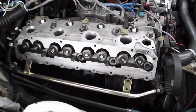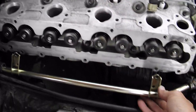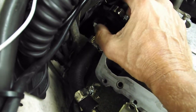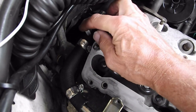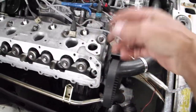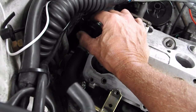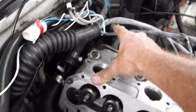So I'm just getting ready to put this back in place, but before I do, I've got to take this tube off. I was just fitting this. This is a little bit of a change from before. I ended up putting this heater tube here in the middle of this line because I don't want too much hot coolant flowing through here and just being recycled back in. So this valve will be nice because I can adjust from basically no coolant flowing through to just a little bit. It's hopefully enough to keep this sensor in an accurate range.